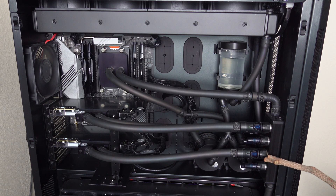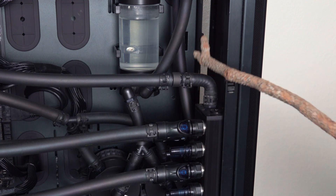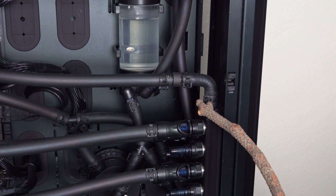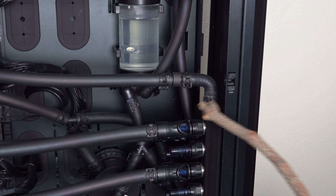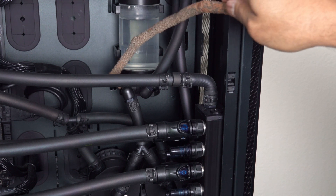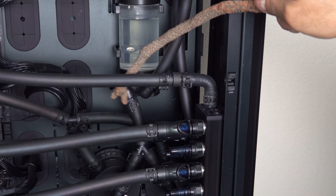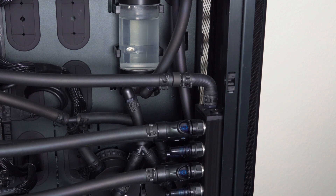The quick disconnects are very efficient and I love the layout of them. Not only do they look really nice, they're also right in line with where you need to place the GPU — so it's well thought out. Xenowulf is always looking for ways to improve upon their connections. You'll see this connection here — it's a direct connection from the junction going 90 degrees into the tubing, which reduces a potential point of failure compared to a 90-degree fitting that screws into the reservoir and then goes into the tube. Reducing points of potential failure is what everybody loves in water cooling.